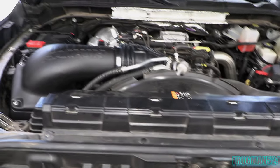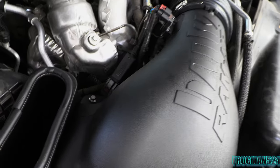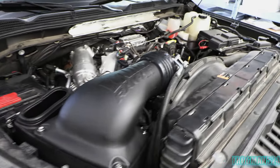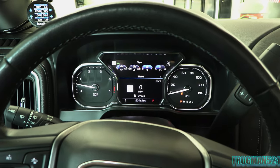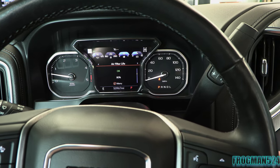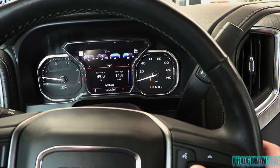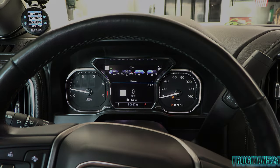The install is complete — very easy, anybody can do it. Banks makes super high quality products; that's why they're not always the first to market, but they are definitely the best to market. Got my zip ties cut, got this away from the heat shield, everything's ready to go. The last thing you need to do is reset your air filter life: toggle over to information, scroll down to air filter life, press menu, hit reset to 100%, and it'll ask if you're sure — just say yes. There you go — 100%. Now you can drive and enjoy your new Banks Ram Air intake. Thanks for watching guys, I'll do a review in the next video.